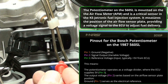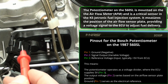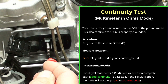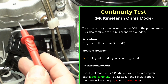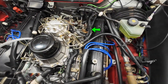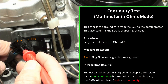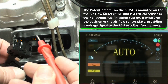It's not controlled anymore. I want to disconnect the plug to make sure that the wiring is what I expect it to be, and make sure I have a good ground because the potentiometer is not going to work without a ground. What I've done is I've connected to chassis ground — actually it's where all the brown wires go on the engine. That's where I'm connected to ground. Now I'm going to go ahead to pin 1 here. At the top, if you look, it's a brown wire, and it is ground.